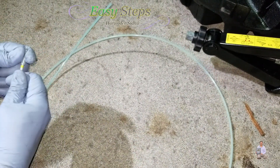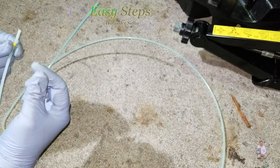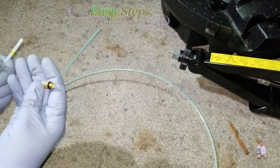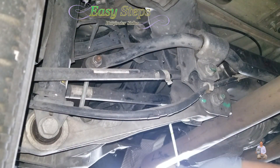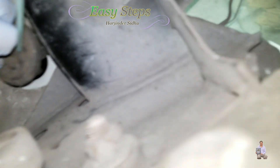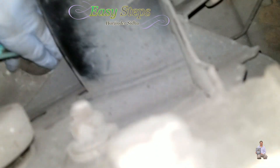What I'm going to do — I'm going to take this one off and insert from the bottom of the car where the rubber grommet is. I'm going to insert that one in, push this one off, then put the new coupling and tighten it on top. I'm going to insert the tubing into the trunk. As you saw the way we took it out, it's going to go into the same hole. I inserted the tubing and I'm going to pull it from the top. I'm going to put this rubber tubing in place.